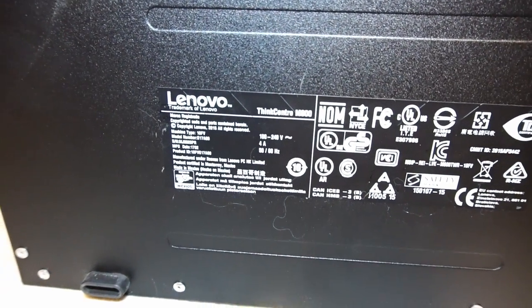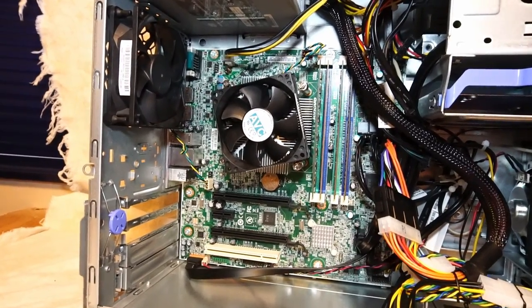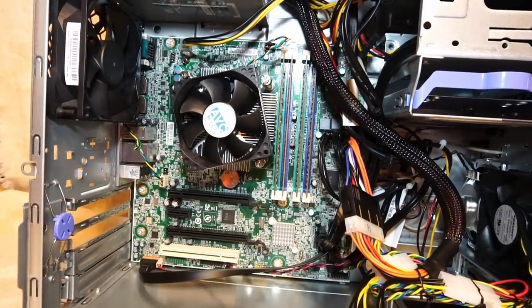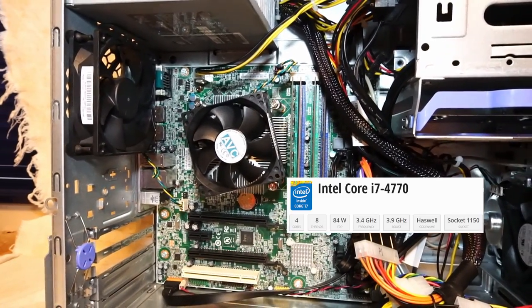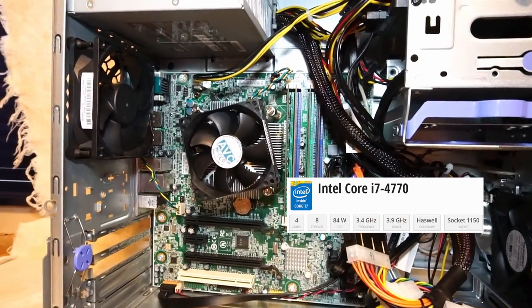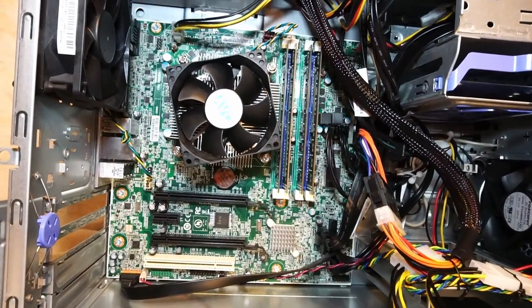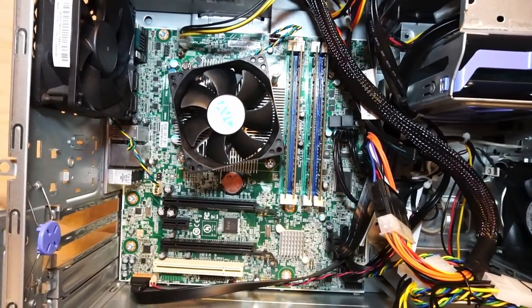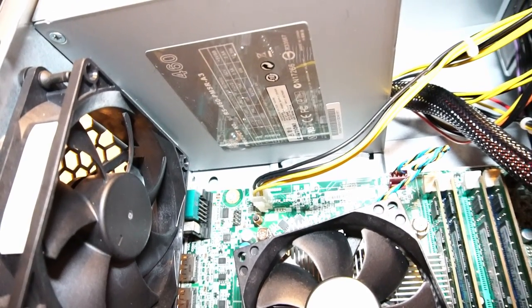The Lenovo case that we have this packed inside belongs to the ThinkCentre M800 series, which normally carries 6th gen Intel, but what we actually have inside is a ThinkCentre M93P motherboard, which supports 4th gen Intel, and we currently have an Intel Core i7-4770 CPU, 4 cores and 8 threads, 16 GB of Samsung DDR3 1600MHz RAM, a Cooler Master 460-watt power supply,